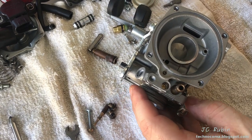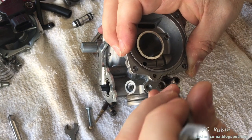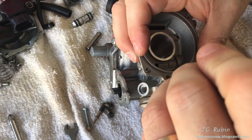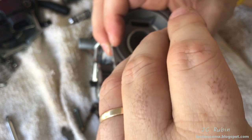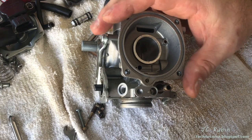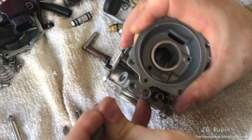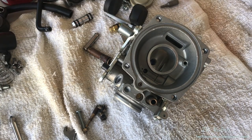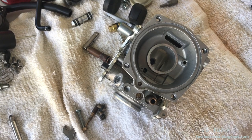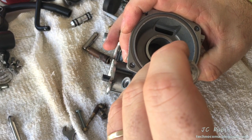Only a couple turns are required to seat the screw into the brass — I can already see the plug start turning. Out it comes. Now we have access to the needle below. We're going to mark the current position of the needle against the carburetor — it's at zero degrees. Then close the needle into full seat, which just means until it stops turning easily. Counting: half, one, half, two — and it stopped just short of two and a half turns. I mark that as position two, calling it less than two and a half, and annotate that on the cover inside so I don't lose it. That allows me to return the needle to the original position. I can now remove this needle safely from the carburetor knowing the exact position.